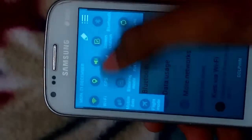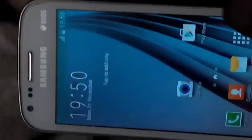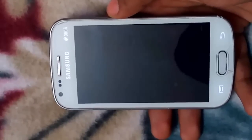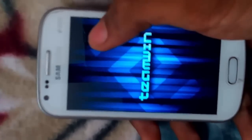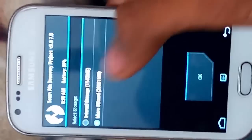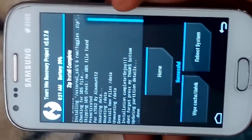You can clearly see that the notification panel currently contains only this one option. Now when I flash the toggle, these icons will increase automatically with some new functions. The procedure is the same — first turn off your device, then press the three buttons together to boot into TWRP recovery. Click on Install, change to micro SD card, find the S6 ROM folder, select the toggle zip, and flash it. It's done — reboot the system.